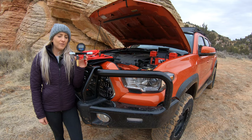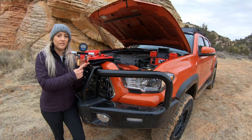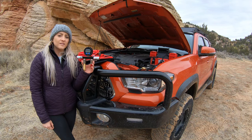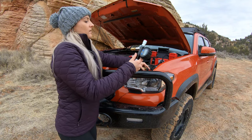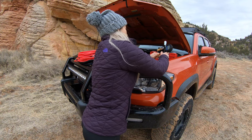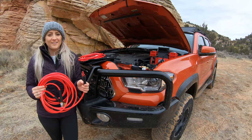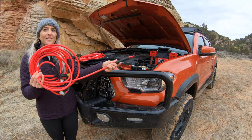I'm going to show you guys how to inflate all four of your tires at once with our EZ Air system. The first step, you want to ensure that the deflate and the inflate valves are both closed. Second step, you want to attach the manifold to your air source — we are using our Beast air compressor. The third step, you want to attach the tire hoses to the manifold and then also to your tires.